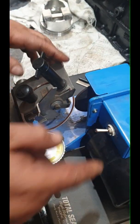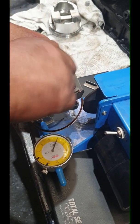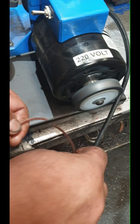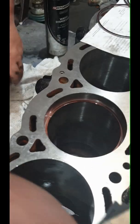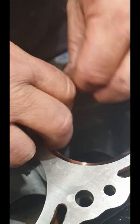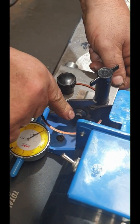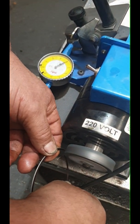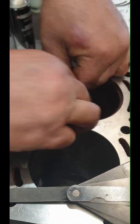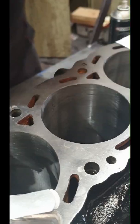So I've set this up and this is how you operate it. Put a little gauge there, set it up on zero, take it off, polish the sides a little bit, pop it in. It takes a long time - not quite, so I'm going to keep going. This is part of blueprinting, what I would call blueprinting. That's two cuts. As you're going to do all the rings, you can imagine how many hours it takes - a lot of work involved.